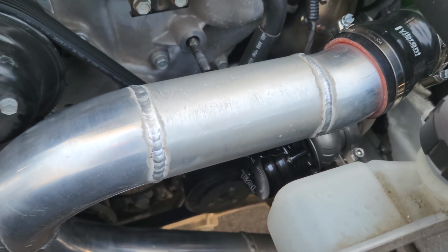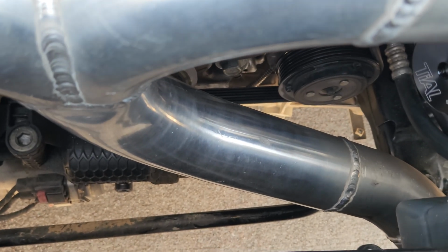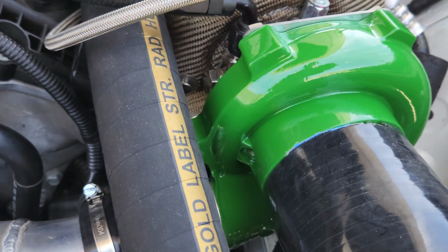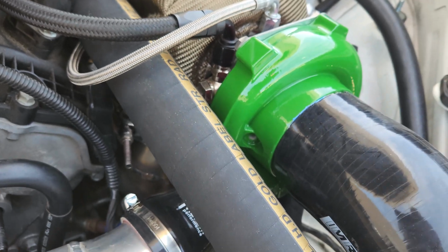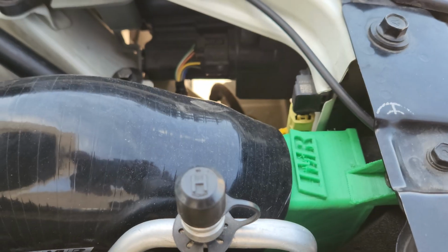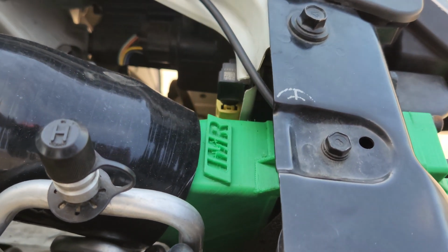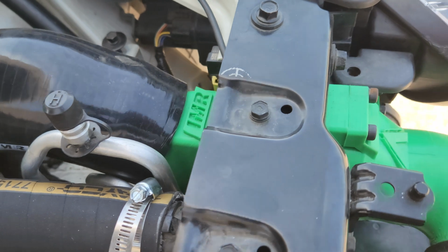All right, so from there, that's the wastegates. They're going to be pointed downward, and the dump tubes are going to be going right down through those holes there. And we have the turbine housing, obviously, of the turbo, and we have the compressor housing. And so that's just basic turbo anatomy. Feeding the turbo, we've created some intakes with our custom couplers, and we've created adapters. The adapter will actually allow you to bolt and mount right to the car. I'll just call this the radiator support. So they're internal and external adapters.